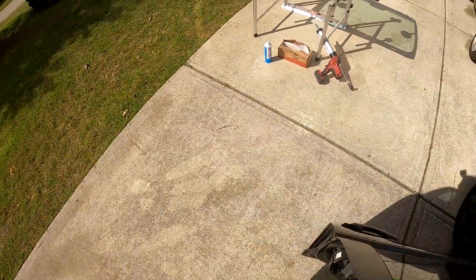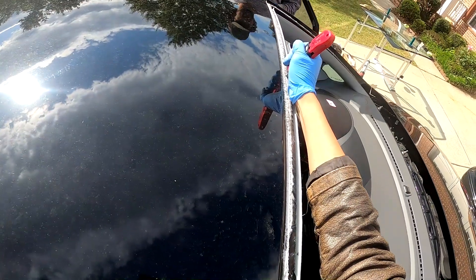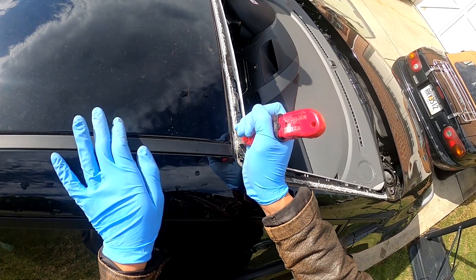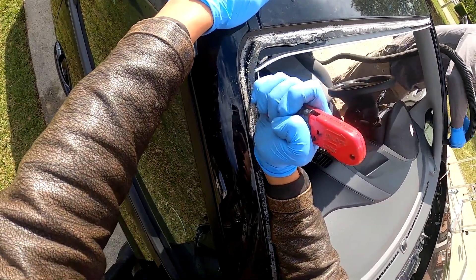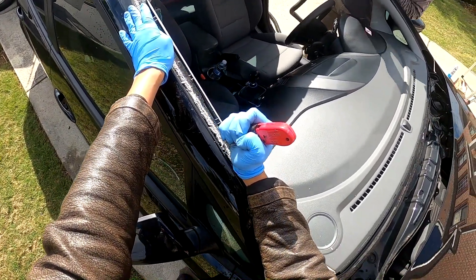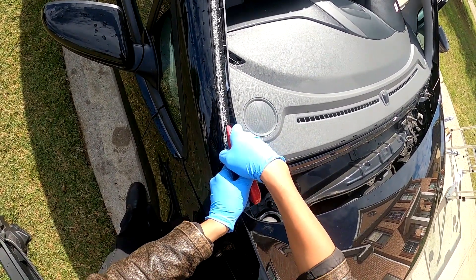Trim all the way across the whole windshield, leaving the old USM molding on the vehicle but still exposing enough urethane so you can cut it cleanly for the new urethane application. Keep in mind that new urethane sticks a whole lot better to old urethane. There is a little bit of white dust from the old USM, so we're going to vacuum it all up and clean it so we can make the best bond with the new urethane. Take your time and be as careful as you can not to scratch the car.